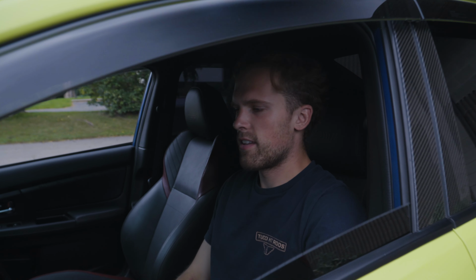What'd we end up at? We ended up at about 290 in Sport Sharp. Sport was about 280, and Intelligent was about 270. Bigger torque difference between the three. Left it at 18 pounds. Got the factory fuel system in it. Pretty much tuned it for speed density, tuned it for the blow-off valve, so he can adjust it softer, harder, whatever, and it's not going to affect the tune at all. Other than that, runs good.